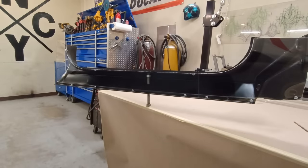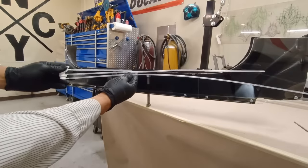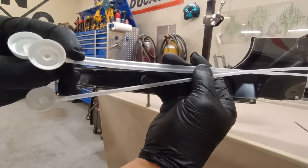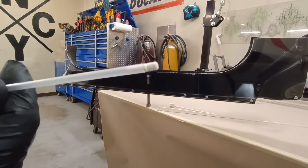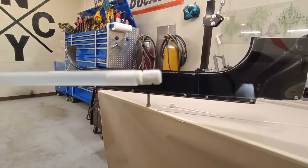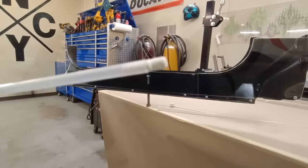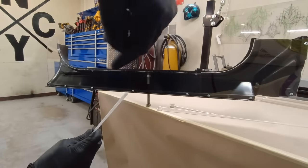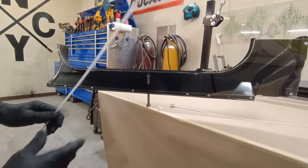What comes in that kit are three different sizes, different lengths of applicator wands. You just remove the nozzle and stick this nozzle on. These aren't just regular lengths of tubes. These ends are special ends. They have a 360-degree conical spray pattern. That means this end, all around it, is going to be spraying 360 degrees. That's really important.